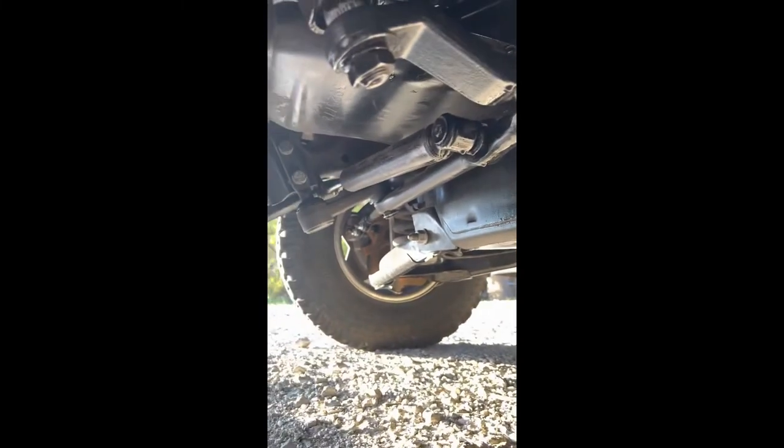And then just putting the hubs on and brake pads and putting the caliper on is just all common sense. Probably found a YouTube video on it. And I just compressed the caliper with the C-clamp and the old brake pad to push the fluid back, and then put the brake pad on and slid it over the rotor. But yeah, everything's holding up.